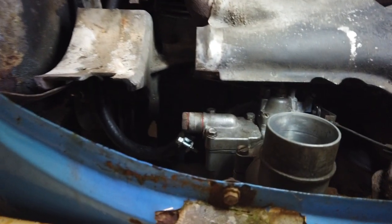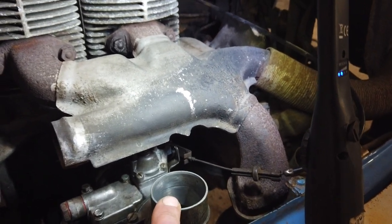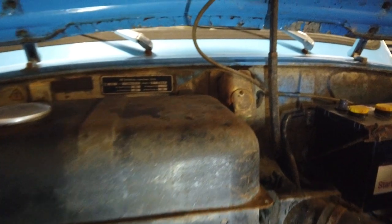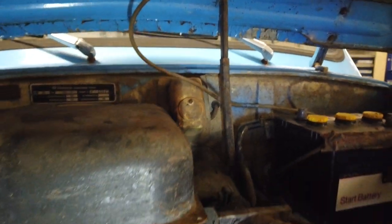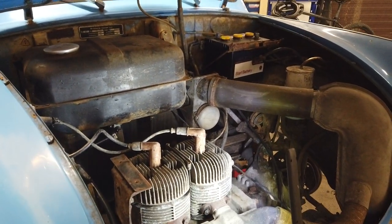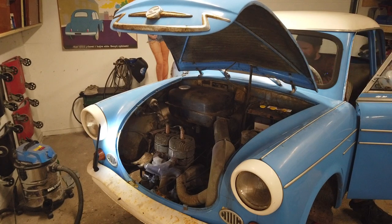The carb is now back at its resting position. I fitted a new fuel line, and the valve up there is installed again along with the fuel tank itself. Unfortunately, the strap that holds it on on this side snapped when I tried to put it on, so I need to make or find a new one of those. But what could be interesting now is to see if it actually works. Let's try.